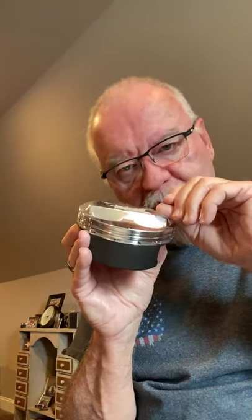because if you're holding the throttle wide open and you're going along at, say, 5,000 RPM and you've got 100 horsepower, a percentage of that pressure is leaking by your rings and going in the bottom end, and it pukes out of the breather, or it pukes out of the head breathers into the air cleaner, and oily mist goes in the air cleaner. And when the oily mist goes into your throttle body, now that oily mist is going to have to be burned. And when it's burned, it creates carbon, compression ratio goes up, and the octane of your gasoline goes down.